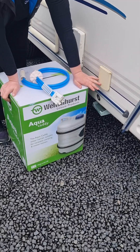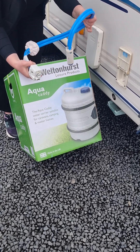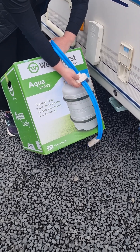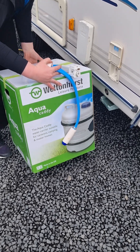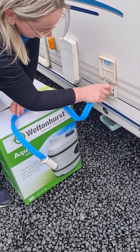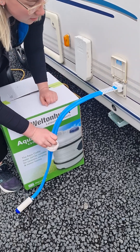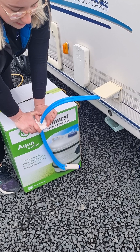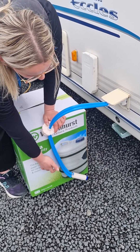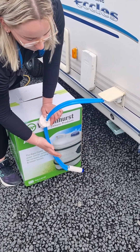On the side of your van here is the connection for your fresh water. You want to fill up your fresh water barrel, undo the lid on the top, and drop your pump hook-up right down to the bottom. There's a little dust cap that sits inside the barrel. You then have your connection to the van — it only goes on one way, just pop that in. Once it's clipped in, push the little flags around on the top and bottom to hold your pump in place. You can then go inside and turn your water pump on. There's no gauge on these caddies, so keep a good eye on them — you don't want them to get below a quarter empty because the pumps can start to curl up out of the water and run dry without you knowing.